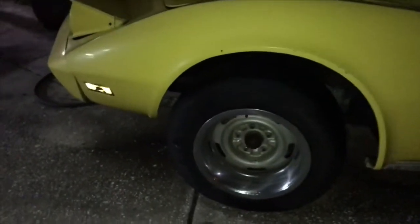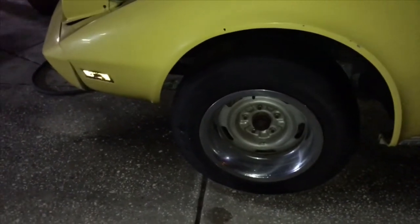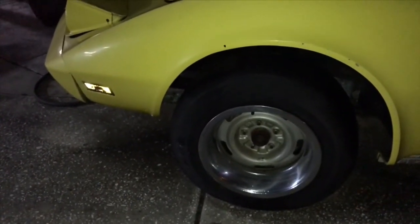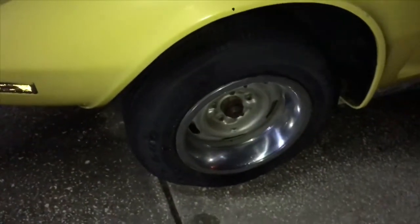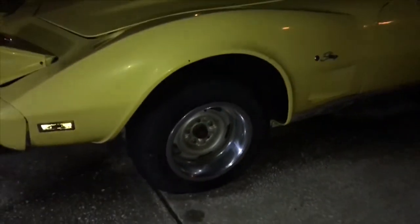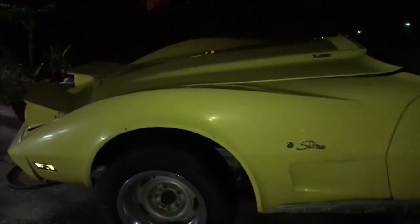And I've got to bleed the brakes, because I still didn't bleed the brakes yet. I put the calipers back on, all the pieces that you saw I had to put on. And those are back on, new brake pads, brake calipers are rebuilt, brake discs got resurfaced, got turned, cleaned the surface off. So the brakes are good to go, we just need to bleed them and put new brake fluid in. This car will be good to go.